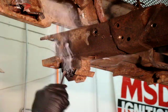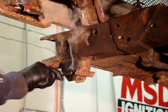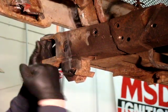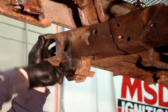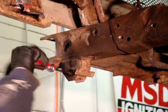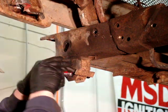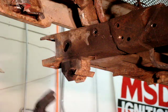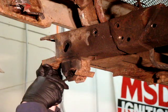What we're going to do is take a standard screwdriver, put it in there, and kind of pinch and angle and twist. There it goes — it just heats it up and then drops right out like that. Once that's out, all that's left is the rubber and then the steel outer sleeve, so we'll pry underneath it.